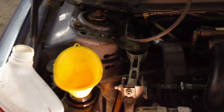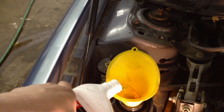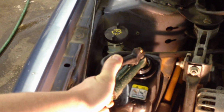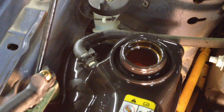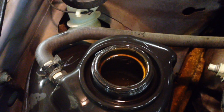Now it's time to add the VC9, the iron out cleaner. Pour it in first so the water goes in afterwards and it'll mix, getting deep into the system instead of floating on top in the bottle. Then fill it back up to the top. Now the water level is holding — you know you've got a full radiator. Go ahead and start it, let it run and do its thing. Once you've got it started, watch that level — it's going to start dropping.